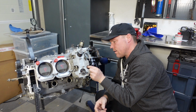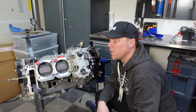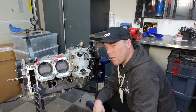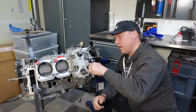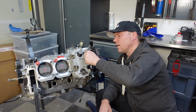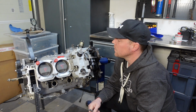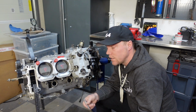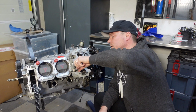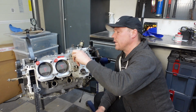I take the nuts and I'm just gonna assemble the nuts. In my build, I used the 993 Turbo cylinder head studs. So these are the ones that are threaded all the way. They're also called Dilavar studs for some of you that have been reading. This one together with the other aftermarket ones like the ARP studs, they're supposed to be the best ones, and they're supposed to be made in a way that you can reuse them. If you disassemble your engine, you can assemble it without changing the studs. That's supposedly the case. I believe them when they tell me that is the case. And they're also supposed to be the best ones for the air-cooled engines.